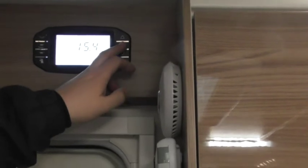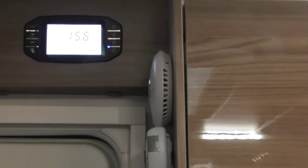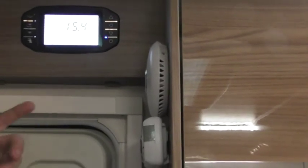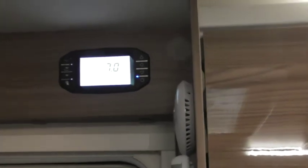Oh, is it? Oh, perfect. Well, you will want to use that. I won't put it on now because we're 16 up there. You can throw as much electric at it. You'll be doing well to trip our electric up there. But obviously, when you're on yours, you can set a 10 amp limit on it, and it means the van will control it rather than it tripping outside.